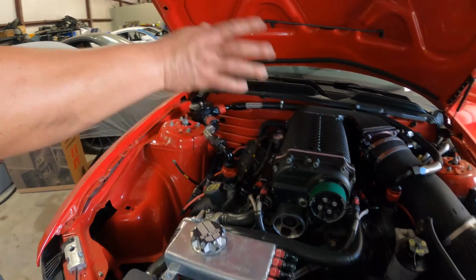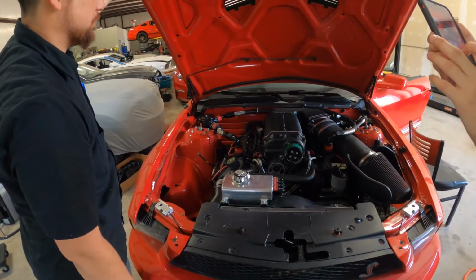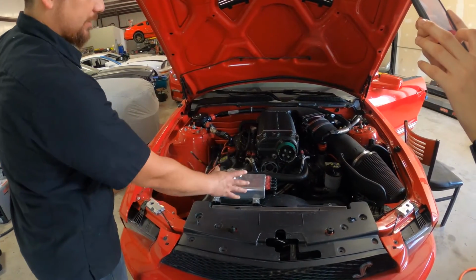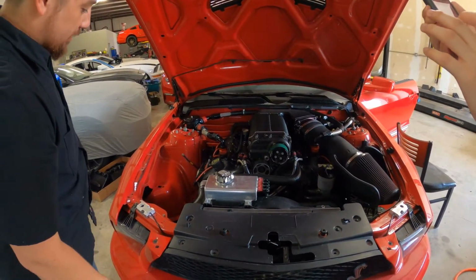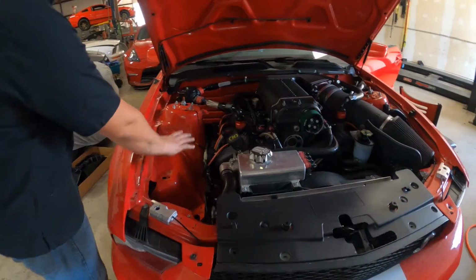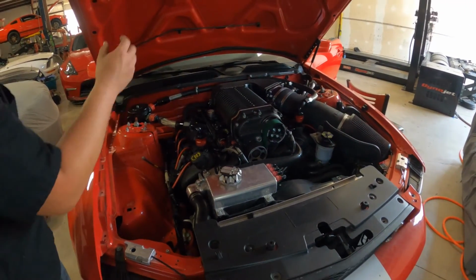Yeah, and then we separate it from the engine, so it's no longer hooked into the intake, and it's no longer hooked into the elbow of the supercharger. It actually just vents direct crankcase pressure directly into this little vent can. You can see all the computer and everything's gone now. It's all mounted under the dash. And the new fuse box is about that big.